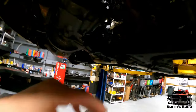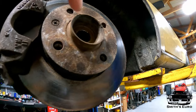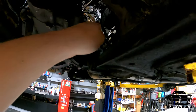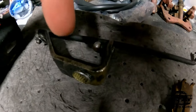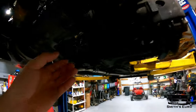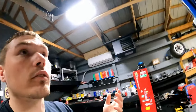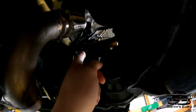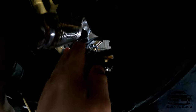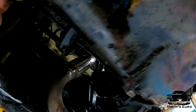On most Mark 1s with this driver-side axle you don't have to take anything out — you don't even have to have the steering wheel loose. You just unbolt the nut, unbolt the axle, and take the shift selector off right here — it's just a 13mm, back that off, and you can just lift the axle straight up and pull it out. Same deal on the passenger side: take the rod out of the shift selector, move it over, pull it up and pull the whole axle out.